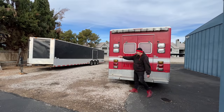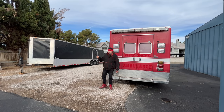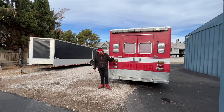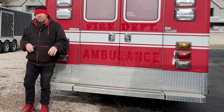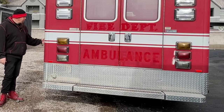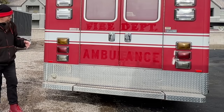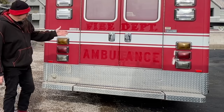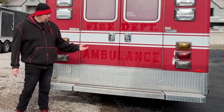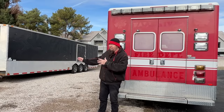This big trailer over here is a 32-foot car hauler. I'm going to be pulling that with this — I normally pull it with my Ford Excursion with the 7.3 liter turbodiesel. This International 4300 Durastar can tow like 60,000 pounds, so I'm not worried about the truck pulling it. But there's no hitch on it — the frame ends way back here. We're going to have to do some work; I need custom welding done to put on a 20,000-pound hitch, since I'm typically hauling up to 10,000 pounds.